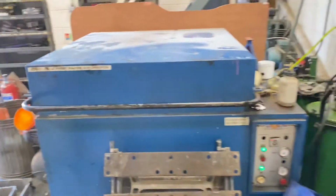Hot water and detergent. The hardest thing for either a small shop or an amateur to do in terms of engine building is actually get it clean enough. I used to spend more time and effort and chemicals trying to clean engine components than I often used to spend building the actual engine. If an engine is to work well and live a long life, it needs to be scrupulously clean when it goes back together.